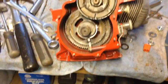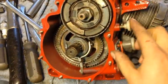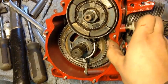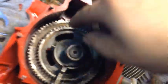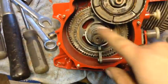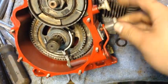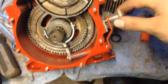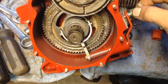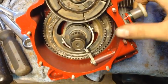I just wanted to show you this — this is how the two-speed works. So you've got your little brake here, and what you would do is push this down, and this will keep the clutch from spinning, because your clutch drum has gears behind it, and that's what drives the big gear and the small gear, which drives your sprocket. So you'd push that brake down, and then while you're holding that brake, you would shift this — by pulling this up, and you can move the gear up or down.